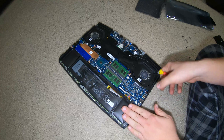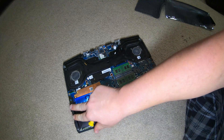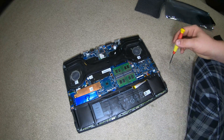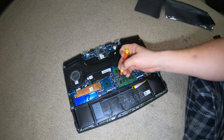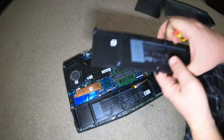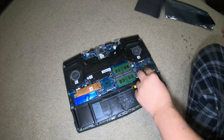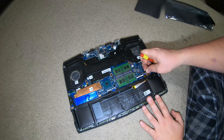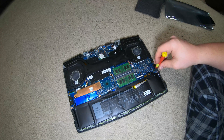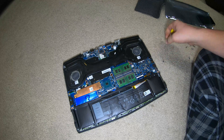There's our battery. I've had it apart before to do different things — this computer's been messed about with by putting coolers on it and all kinds of stuff. To take this battery out, there's a screw right here, right here, right here. If you don't know where they're at, you can look at the new unit — three on the bottom, three on the top. Make sure you pull that clip before you start doing any work, pull straight up and it will kill everything.